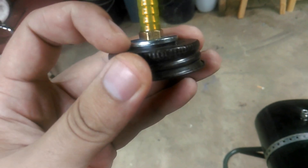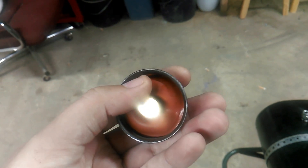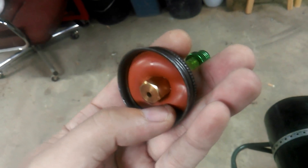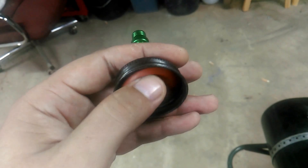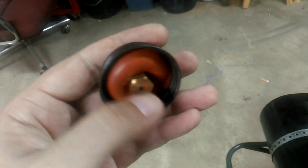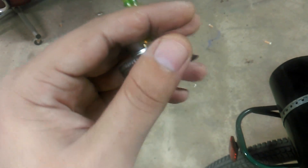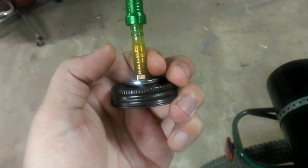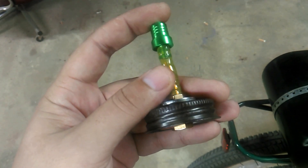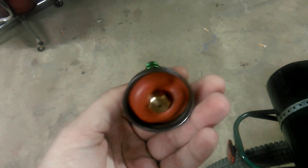I put a steel washer and then a neoprene washer on top, and lined the interior with rubber — I'll mention more about that rubber in a moment. I had to use a cap because they didn't have a fine thread bolt I could use, and it's probably better that way. I drilled a small hole in that cap, threaded it up, and it's really tight and a hundred percent fuel tight — no leaking at all. I got the vent cap off eBay for about two bucks for two of them.